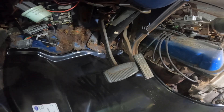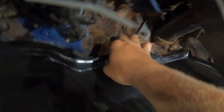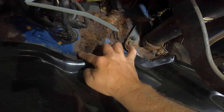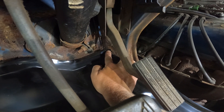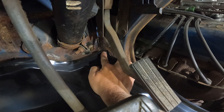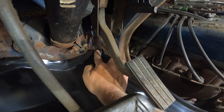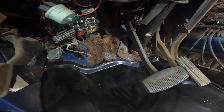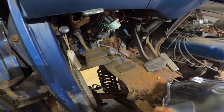If there's one thing I've learned over the years, it's test fit, test fit, test fit. Cut a little, test fit. Cut a little, test fit. This bends in just a little bit towards the firewall, so that's all going to need to bend up flat because we're going to save all that and use it to cover all that garbage there. This corner over here is hitting a little bit, so I'm going to take this floor pan patch over to the bench and finesse that with the vise and see if I can get that to bend back and give us a little more clearance. We don't want to cut more material than we have material to patch. But it's looking really good - feeling really good about this.